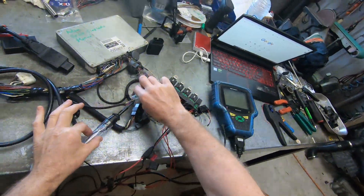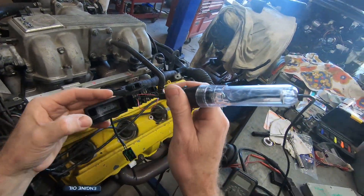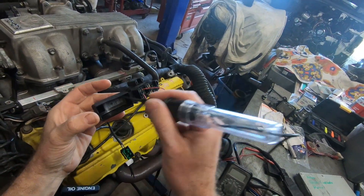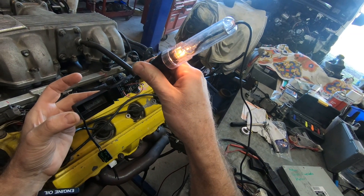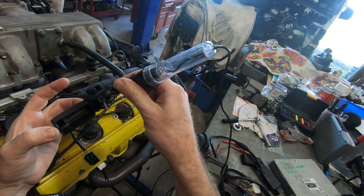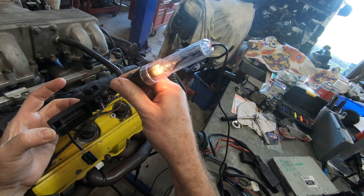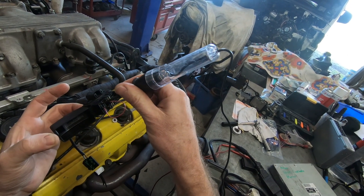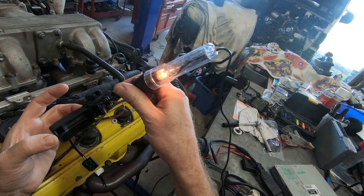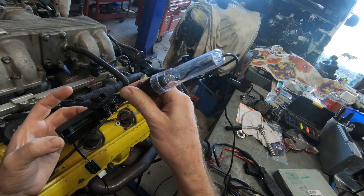I could also do the same test in DLC2 — TE1 and E1 — and we should get the same result. There it goes. The long ones are tens and the shorter ones are individuals — so that's code 56.